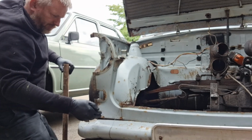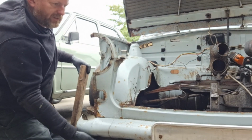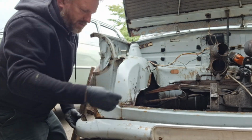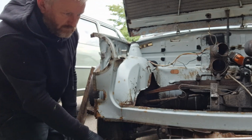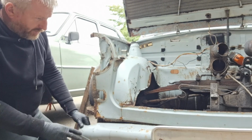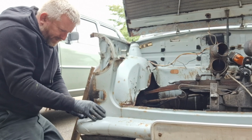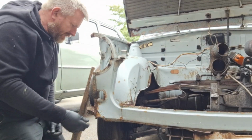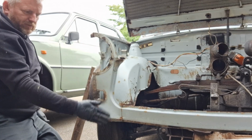Okay, this front panel has come out. So it should be flat, then curl, follow the profile of the bumper. I think far off. The bracket on the bumper there, can't really see it here, you can see where that is in line with where it pulled spot welds out. So it needs to go that way a little bit across at the bottom maybe, and definitely up. This needs to go in a bit, because that's not flat. That should be flat with that, match that.